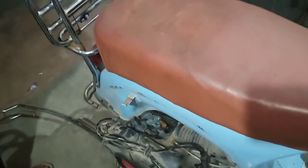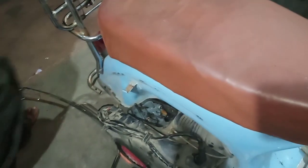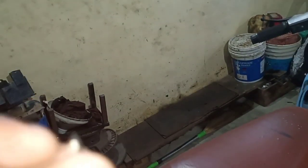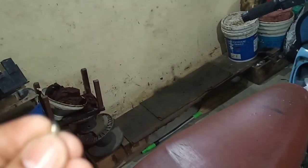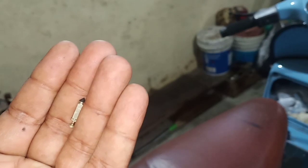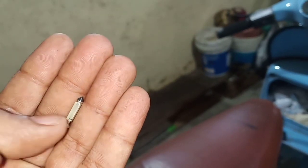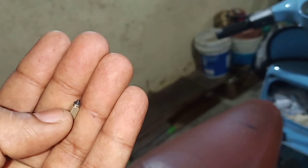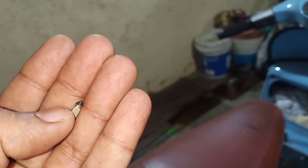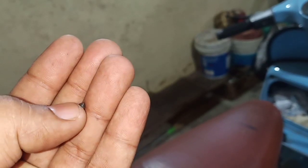The spark strength was good and other things were working pretty well. However, we found out that there was a little overflow problem and the culprit was this pin. There is a tiny groove at the top of this cone — it's pretty miniscule, you can't really observe it without closely watching. You can see this groove right?